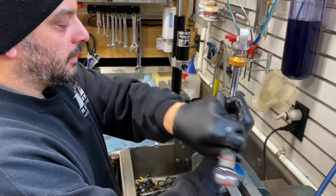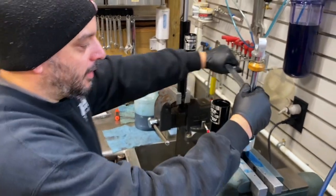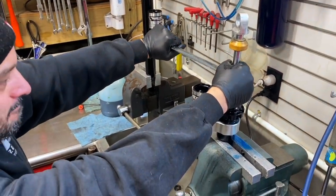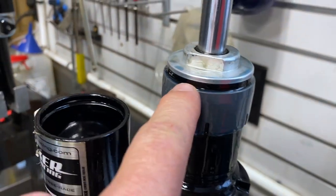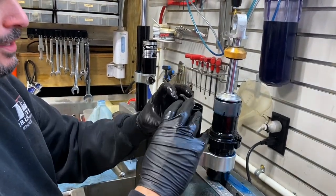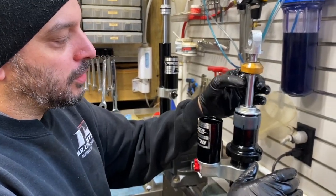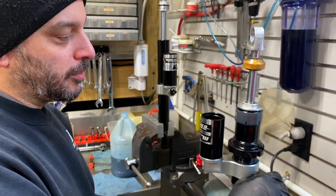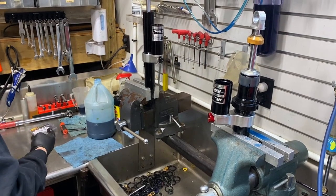How tight do you need to go with that? There is a torque spec, but honestly I don't know this particular shock off the top of my head. You can feel it — you're obviously looking not to get any oil leaking at that point. Oil will spit out initially, but once the shock is cleaned off and charged, you don't want to see any oil leaking anywhere. You can have a little bit of residual — like if you push the shock in and it returns you might see a mark — that's all normal. You just obviously don't want to see actual leakage.